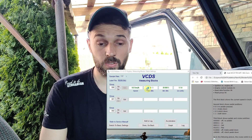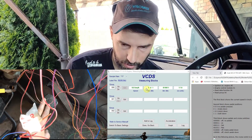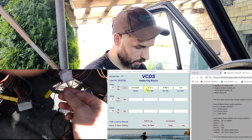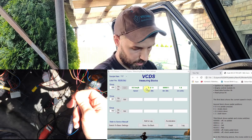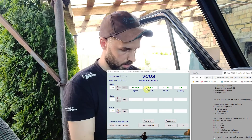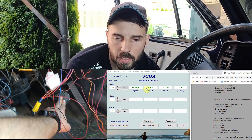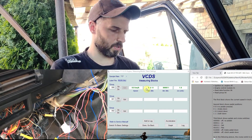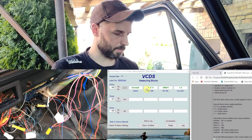But how are you going to use your cruise control if half of the brake pedal is pressed? I can see I'm not pressing anything. Pin number nine is not getting any signal. Giving it a positive signal changes nothing, but a negative signal does change it. So to turn on the cruise control it requires a negative — the negative is permanently connected. Testing the pedals: pressing the clutch changes the bit, pressing the brake changes the bit.